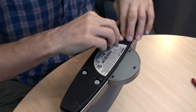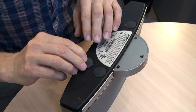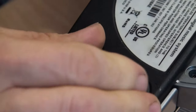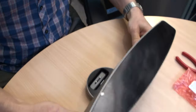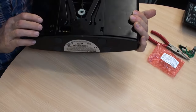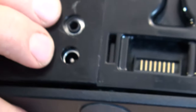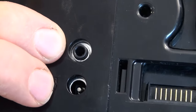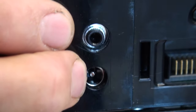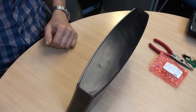Stick your four rubber feet back on, put your battery back in, and away you go — the dock is working again. You can see the new connector board mounted in metal with a replaceable 3.5mm stereo jack socket and a metal power supply receptor. The whole thing is quite a bit stronger than the original. That's how you change the PIO board on a Bose SoundDock Portable.